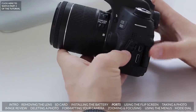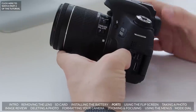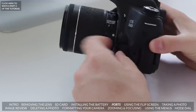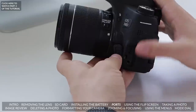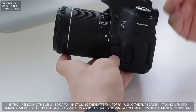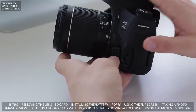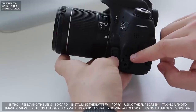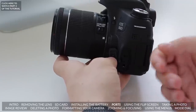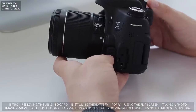We also have an HDMI port, which is really useful if you want to get your images up onto a TV or HDTV, or if you want to get an uncompressed signal out of your camera for pro video work. We also have a port for your microphone — you can put a wireless lavalier or a shotgun mic in using this 3.5mm jack and you're going to get a lot better audio than from the inbuilt mics. We also have a slot here for a remote control or an intervalometer, which lets you remotely use the shutter button and do time lapses.